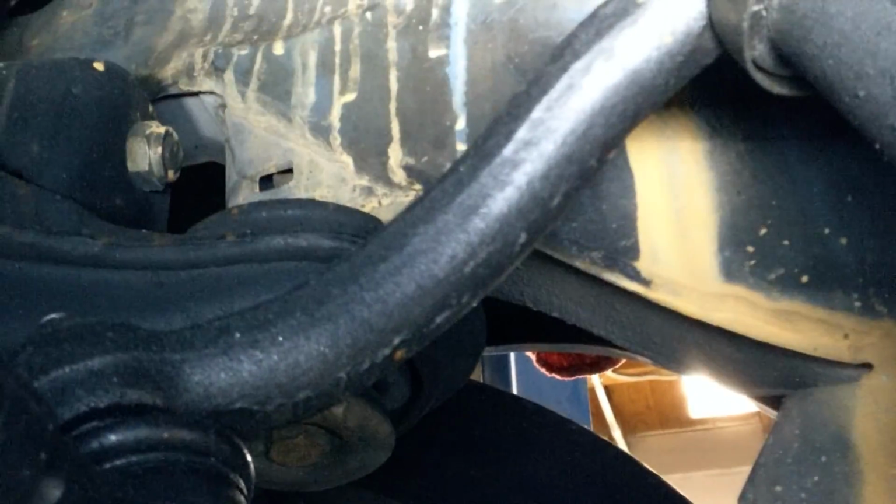And the other things we talked about were the coolant leak. You can see this is like a rusty water trail from the right corner passenger side of the engine compartment. So we replaced the heater valve setup with an update, and then we also replaced an auxiliary water pump on the top. The other thing we also noted was the coolant reservoir was cracked.